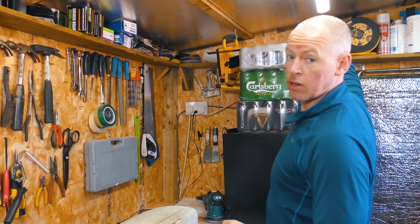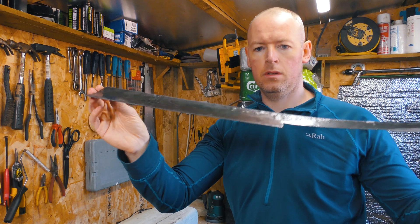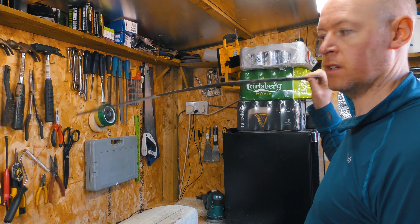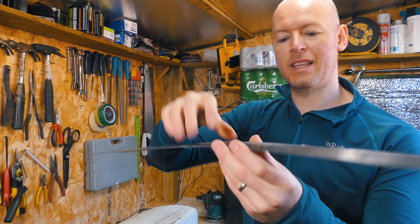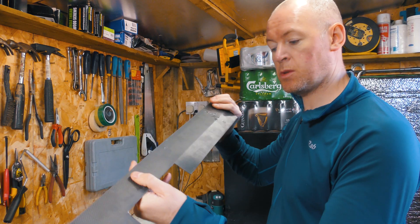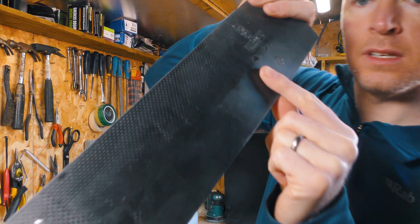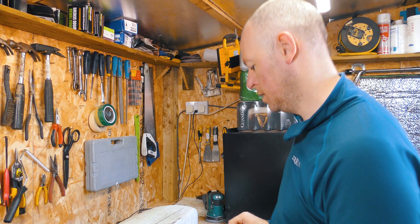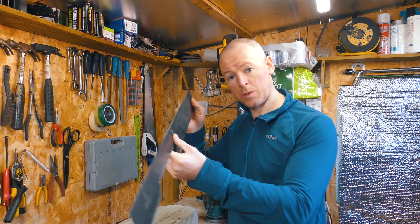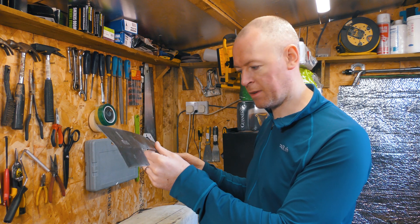The other thing I've done is a Mark II on the carbon fibre radiator scoop. This is much sturdier, still got a bit of flippy floppy on it but it's much better. This narrow part is just a flat sheet so it's got a bit of bend in this position. But this one has come out much nicer. Still got a few holes in it so I'll have to fill them in with a bit of epoxy resin before I fill it with silica powder. And then this one can go on Dave's STI, but this one can come out better — practice makes perfect.